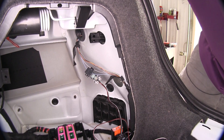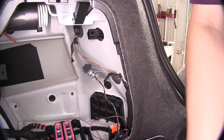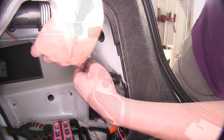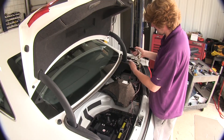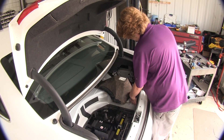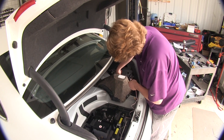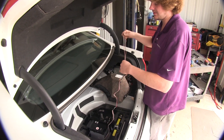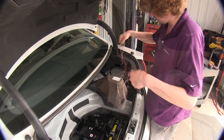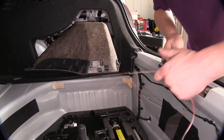Next, we'll take our wire labeled for tail lamps and this is going to clip around the solid gray wire. We're going to take our whole harness here and set it inside of here because this is where we're going to be keeping most of it. We're going to separate out the wire for the left turn signal, come underneath our panel here, and then begin running it over.